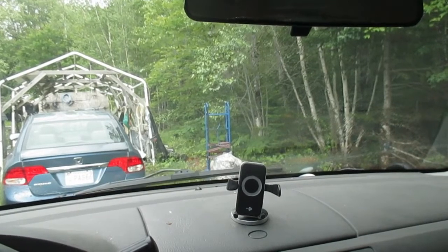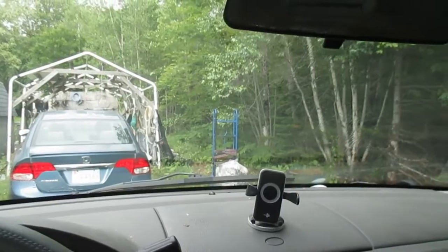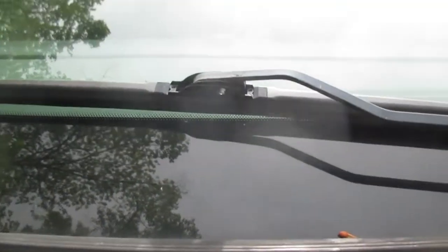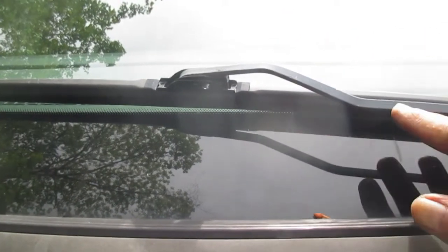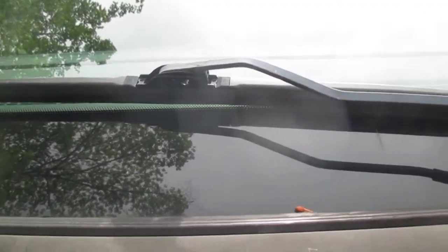I've actually created this problem just to illustrate to you how this happens, because I've run into it quite a lot. This problem is very common in colder climates. Reason being, what happens is ice gets on the windshield wiper, it freezes to the glass, you turn on your windshield wipers, not realizing it's froze down to the windshield.